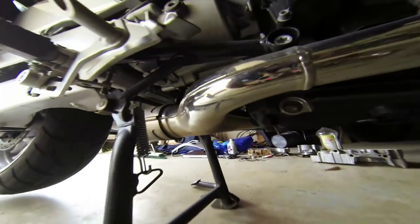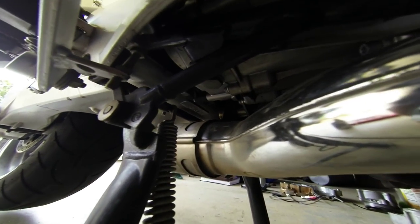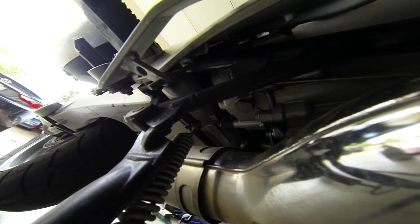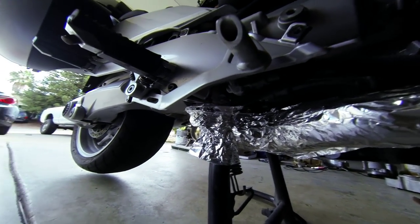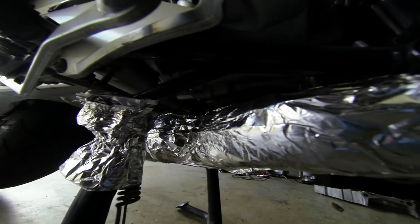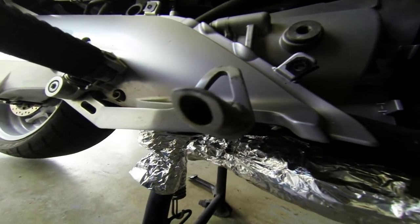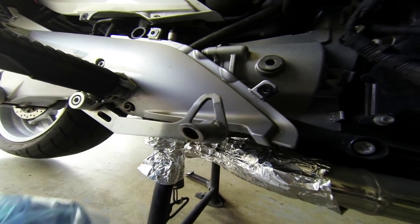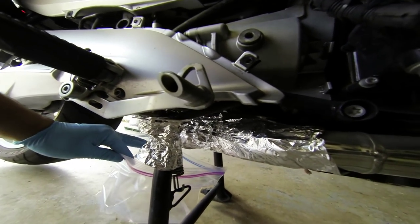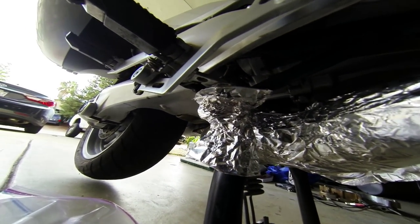Now here's what I'm going to do: I'm going to get a piece of tin foil and cover all this up over here so I don't get oil on my exhaust — I don't want to smell that ugly smell until it burns off. I've wrapped up anything of importance down here; I don't like oil on my kickstand or pipe. So I'm going to loosen that nut and, in theory, catch the oil in this gallon Ziploc baggie, then transfer it over. Hopefully it works.